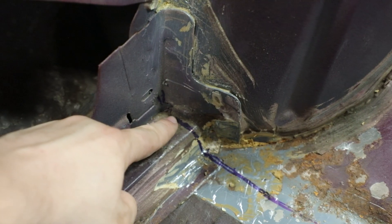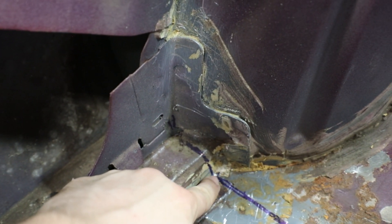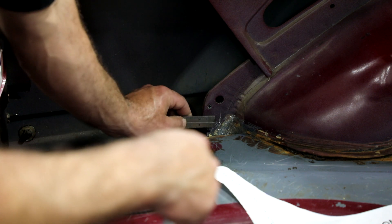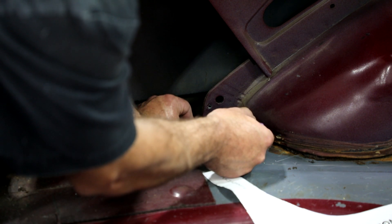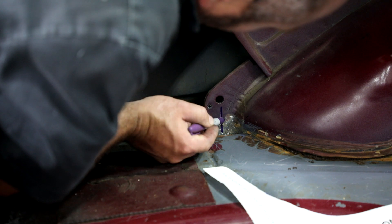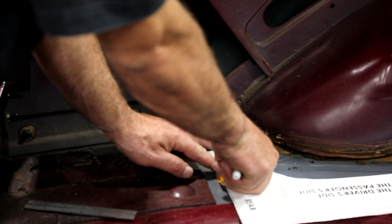Draw a reference line straight off the front corner of the wheel tub inward. You do not want this reference line up against the profile of the wheel tub. Transfer a reference mark by measuring from the back of the outer wheel tub to the end of the wheel tub flange at the trunk floor. Transfer that mark to the inboard side of the flange behind the inner wheel tub — the reference mark should be about one inch. Draw a vertical reference line at this transferred location on the wheel tub flange, then cut out the provided mini tub template.